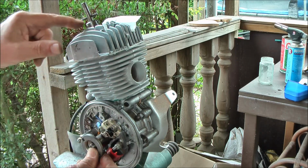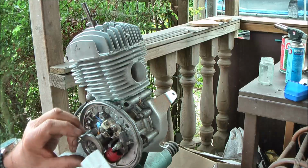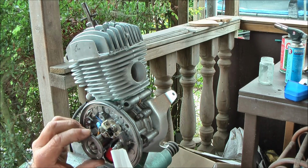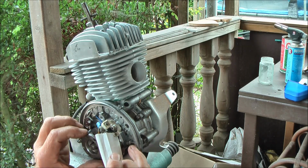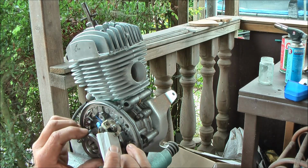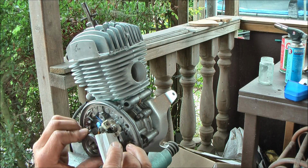Okay, so while keeping the piston in the same position, I'll twist this in such a direction that it first closes. Then I put this in between, cigarette paper. Then I go further and try pulling like that until it slips. Crankshaft is not turning because that would make the piston turn. Yes. Okay. This is the moment.